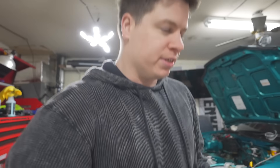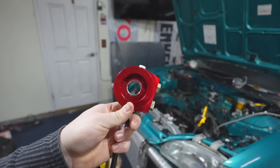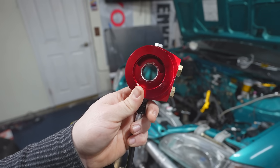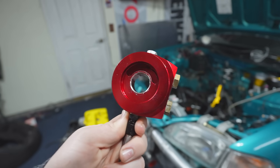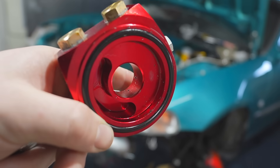We got insanely lucky. You might be asking where did the metal come from that we saw — I found the culprit. Not only was this one part restricting my oil flow because I plumbed it wrong, but this is also where the metal was coming from. Here's the culprit right here. The center locking nut they send you is either too small or just doesn't work properly, so the edges of the nut itself actually dig into this, and you can see burrs still hanging on just from it being scraped away.